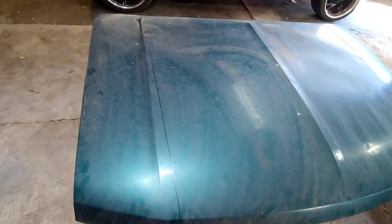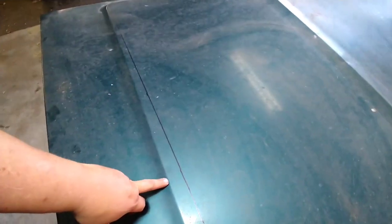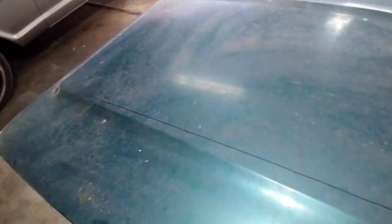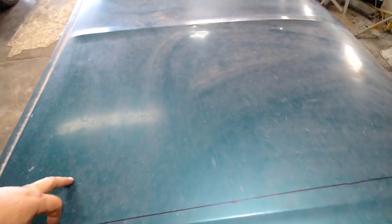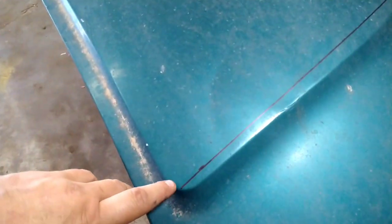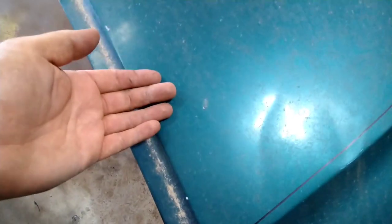You can kind of see here what I'm going for. I just went off of this factory seam — this crease — and back here I measured over half an inch from the crease in the middle, an inch, and up here an inch and a half. I'm going to cut it all the way to this factory bend. I've done that on both sides. I'm not going to cut across here on the front — I'm going to leave it where I can just pick it up and break it loose from the factory glue and the support brackets underneath. Then I'm going to cut the back right on top of here all the way across so we can raise this thing up.